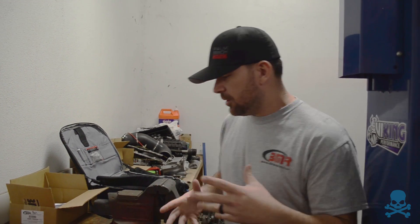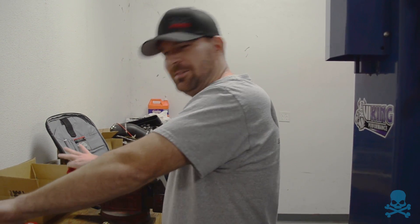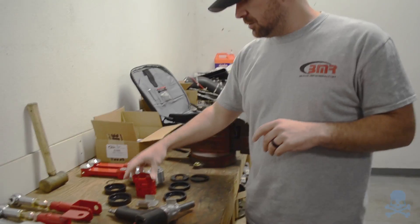Sheldon Lewis and then Jimmy K from Palm Beach Dyno just went sevens with a 6R80. Those cars are a little bit different because they're making so much power that something like this will deflect too much. I have a whole different array of parts for a car like that with different shock settings. That's next level — the average person doesn't do that. So if a person wants to build a car, put a blower on it, go low nines — at what point do we switch from this setup to the other one?